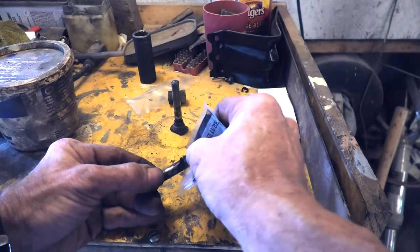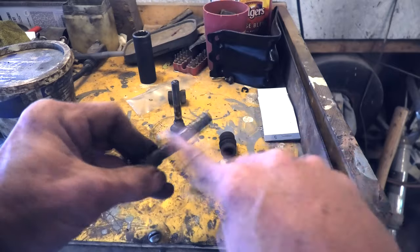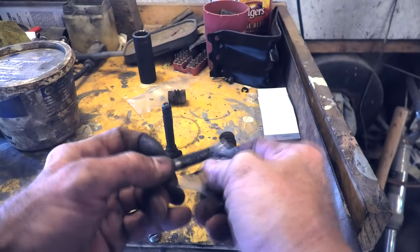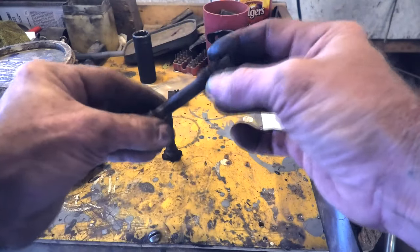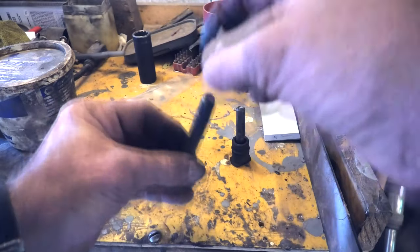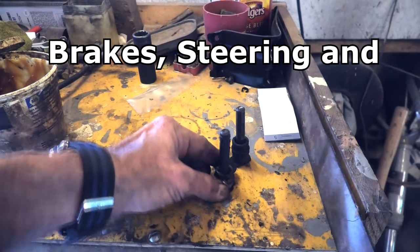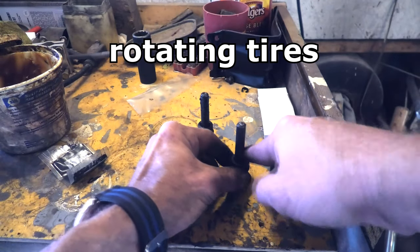Most of the grease wiped off. I'm going to put more of the included grease — if I wasn't doing this video I'd just be dipping into my grease container. I still am adding some of the other grease. What else I've used in the past? Anti-seize, though I've also used regular grease. Eventually, even in the Northeast, they still seem to end up rusting fast. My own stuff I usually once a year, right around inspection, take them off, re-lube them up, and it seems to keep them alive. If you let it go two or three years with salt and nasty weather they'll all end up stuck. We're packing in the Napa wheel bearing grease to lube it up good — can't have enough lubrication on these.